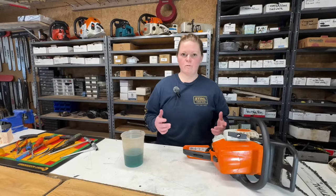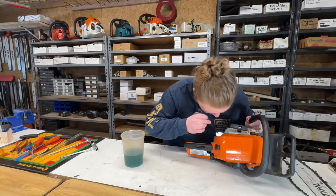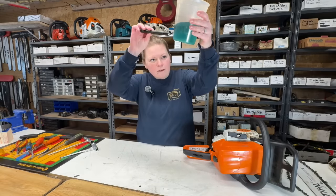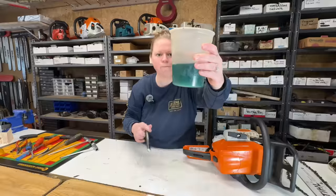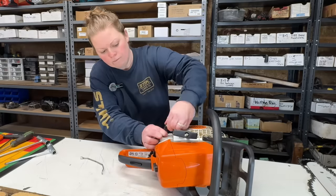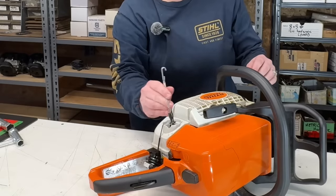Okay, we got the fuel dumped out. The fuel tank looks clean inside, fuel line looks fine, fuel filter looks clean — we'll have a closer look in a minute. There are lots of floaties in the fuel. I'm going to pull the fuel line out, get the fuel filter off, and we're going to pressurize the fuel line and the carburetor just to make sure there's no leaks. The other side of this tool is a fuel line holder, so I'll attach that to hold the fuel line up.